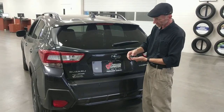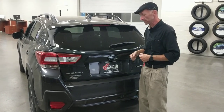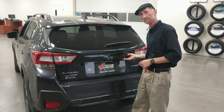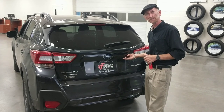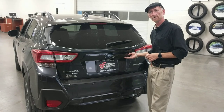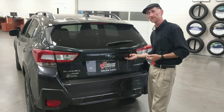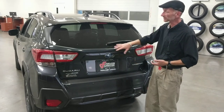We're going to respond using the key fob. We're going to press the lock button one time, and that tells it we're going to program a number. We're going to use an easy one — five digits: 3, 2, 1, 2, 3. Here's our first number and the car chirps. Now we're going to press two times — one, two — and the car chirps. It chirps after every number, and then the last number is three: one, two, three. So our number is programmed in the first time and the car is chirping.